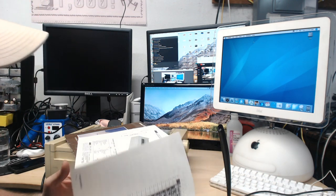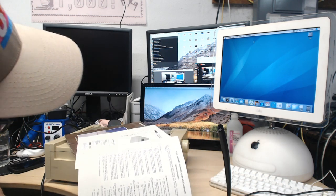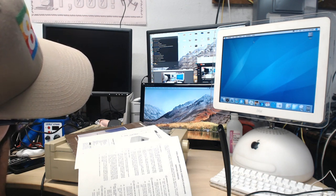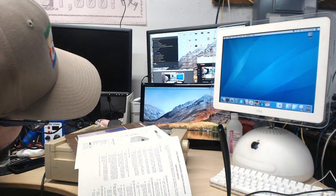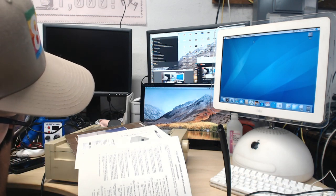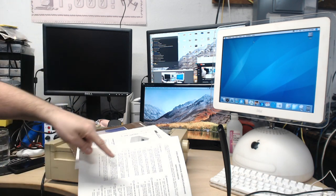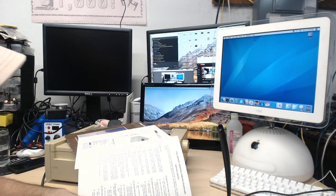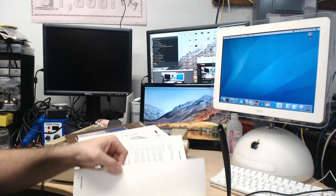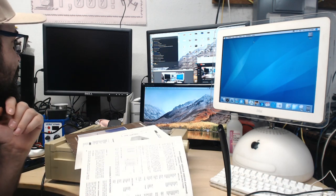Yeah, it's just the way the head is there. Oh, these are some cool pictures too. Power supply, let's see, will not print, check for shortened return, position switch, check operation, check ROM, missing dots, carrier motor malfunctioning, line feed motor malfunctioning, will not print by computer command. Yeah, if I'm looking at these troubleshooting steps and I said, hey, I can't print, I would assume it would suggest doing the self-print if there was one, but there may not be one on this particular one.